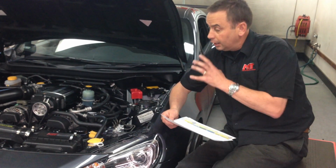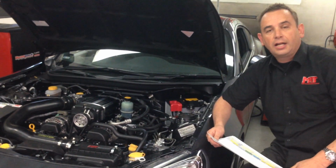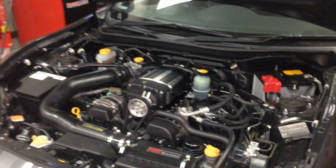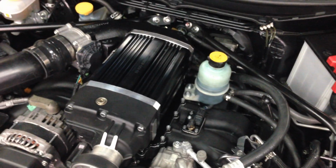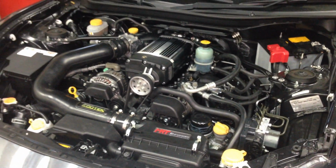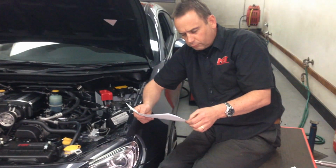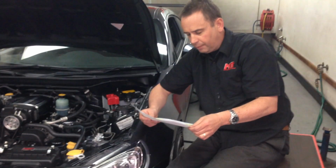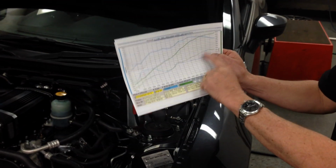So it's an incredible difference in drivability. What you'll also notice on the graph is that even with this larger supercharger, bottom end performance right down as low as 2,500 RPM is still higher than the smaller supercharger, because of the way the EcuteK design runs with a positive displacement supercharger. From a summary point of view, let's compare the factory standard engine with no forced induction to this setup. It's got 190 Newton meters at 2,750, and then running the largest supercharger with that size pulley at the same RPM, it's up around 230, but after there it just climbs, because peak torque on this car dips at about 4,000 RPM, as we all know. You can see this dip in the graph, which we'll show in detail on the dyno graph we'll load to a website.